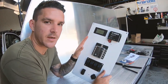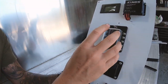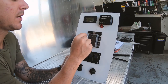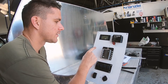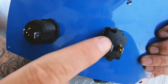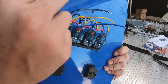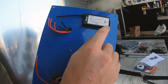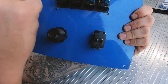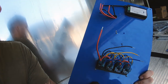The first thing is to wire up as much as we can outside of the canopy. Pretty much everything on the positive side is going to run through this fuse block here, so all we have to do is run 12 volt from the battery to the top of this, pop a fuse in, and then you can get 12 volt out. For the negative side, I'm going to make a common — I'll put a bolt here and feed everything that's earth to that, then earth that back to the battery.